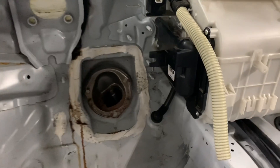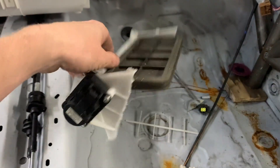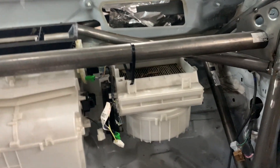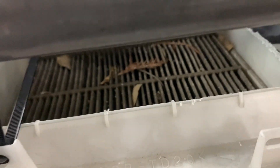Just a few minor modifications. The AC box is in. I did have to cut out the recirc slash fresh air door to fit back here in the cage, so that means I'll make a block-off panel for that and weld that up. Having just air recirculating inside the cabin should be plenty fine. That filter has seen way better days.